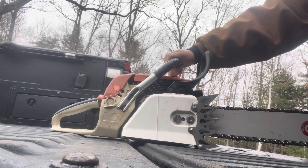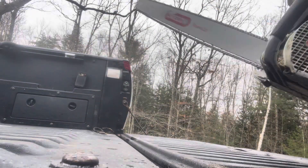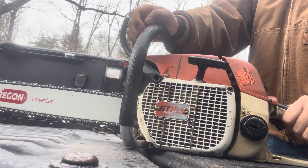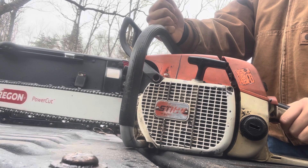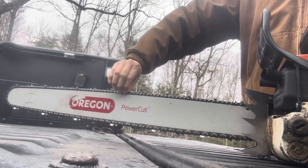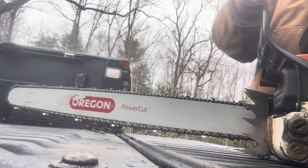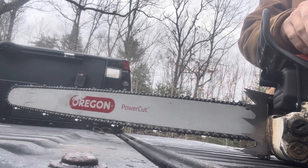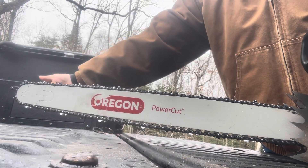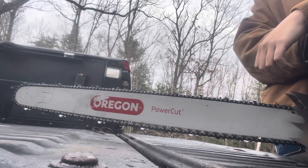It's a lot harder on the saw to have a tight chain all the time — harder on the bearings and on the actual sprocket. On cheaper saws where the sprocket is built onto the clutch, it will wear the sprocket out prematurely. It also runs the risk of creating grooves; when you spin the chain you'll feel it get tight in some spots and looser in others. That's a sign of either a bent crankshaft or a bad sprocket. It's also extremely hard on the bar tips, focusing strain on the bearings there, and overall it's not good to have an overly tight chain in storage.